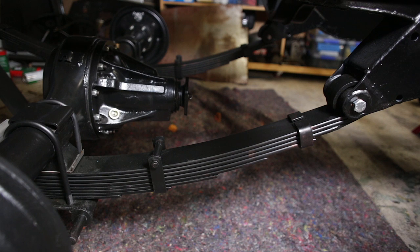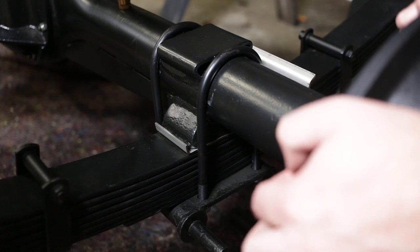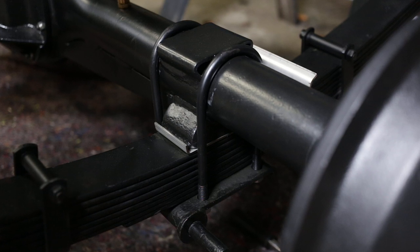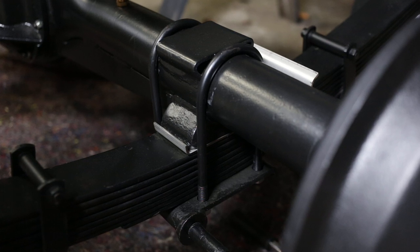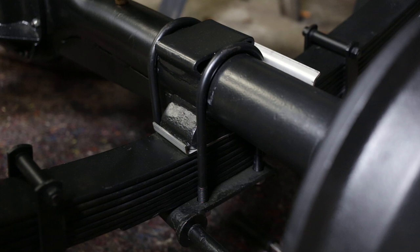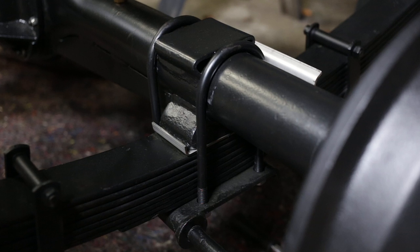Okay, before I tighten up the U-bolt nuts, I want to check the alignment of the rear axle, because there's a bit of slop in the other side. This is happening because the locating hole on the underside of the axle is larger than it should be. I don't know how that would happen, and it doesn't look ovalized or anything like that. I guess it's possible Land Rover left some adjustment on purpose, but I doubt it. Probably someone drilled it out to fit the head of a larger bolt or something. I have no idea why or how, but I want to make sure that both sides are aligned the same.